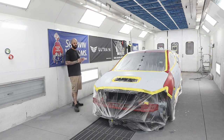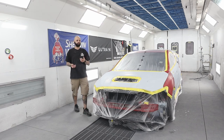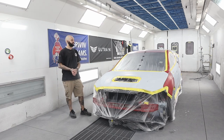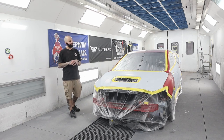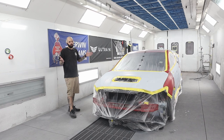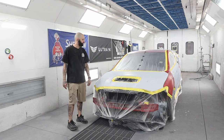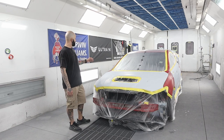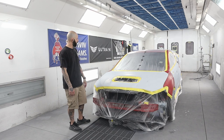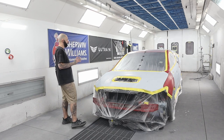But the bumper — we tried to get them to get a new one, they didn't go for it. So the bumper is still not perfect. Honestly, it's pretty rough. So I'm going to do two coats of sealer on that, hopefully smooth most of it out. Like I said guys, this is a dealership car. We have to work with what we got. So I'm going to go ahead and mix sealer, get suited up. This has already been cleaned. All I need to do is take my blow gun, blow air over the whole thing, and tack rag. We'll be ready for sealer.